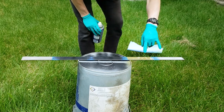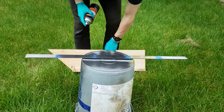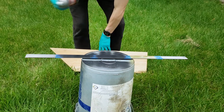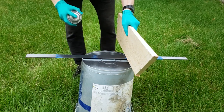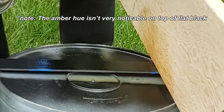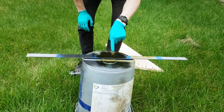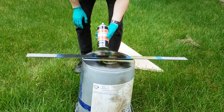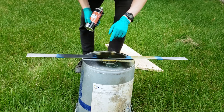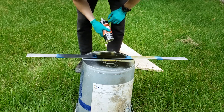I sprayed these on really, really heavy, so hopefully that proves better than worse. It's been about half an hour — let's apply the RP-342 to that coat of Tremclad rust reformer. This combination of Tremclad rust reformer and Cosmoline RP-342, by the way, is the exact combination I'm doing on the frame of the Rover 1 project — the Jeep YJ frame. So hopefully this turns out really good, or else I've wasted eight weeks of my time fixing up this frame.